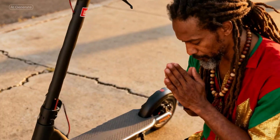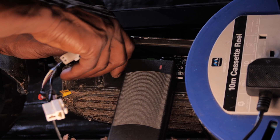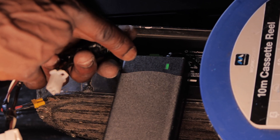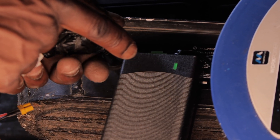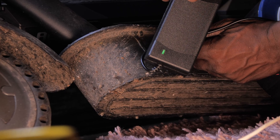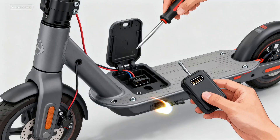Now plug and pray. Connect the charger to your scooter or e-bike. Normally the green light should flip to red — charging! If it stays green, maybe your battery's already full, but let's be real, that's not why you're here. More likely your charging port is dirty, bent, or loose. Try this trick: wiggle the charger jack gently — gently, don't go crazy — while watching the light on the charger. If it flickers red, your port is loose. You can hold it in the sweet spot for now, but don't let your dog trip over the cord. The real fix is replacing the charging port.